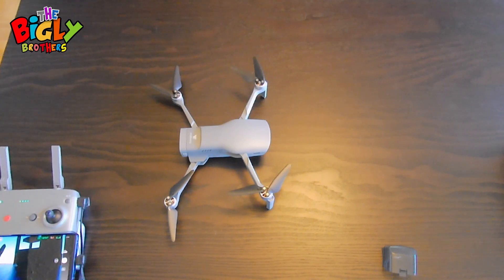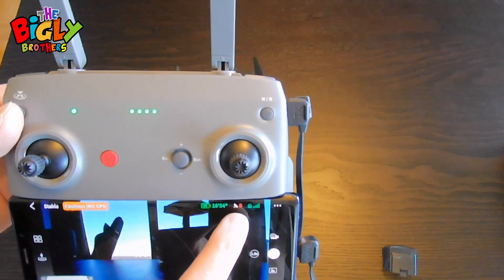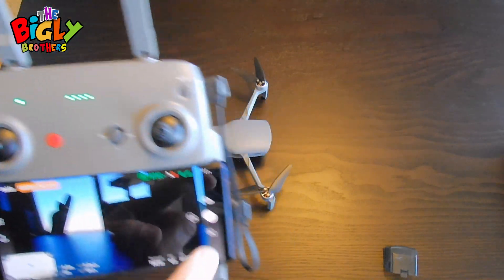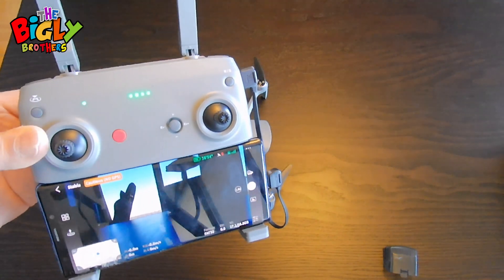The nice thing is with this drone, you don't have to perform the usual geomagnetic and gyro calibrations you do with other drones. When you go to the spot you want to fly outside, once it finds the GPS satellites, it will locate the point where you started up as the home point. On the screen it will show you the number of satellites. When you get over 10 to 12, the drone will be able to start up, and it will record the starting point for return to home. If you ever have any problems, press the return to home button and the drone will come back to that point.